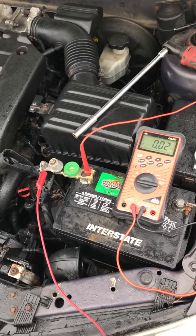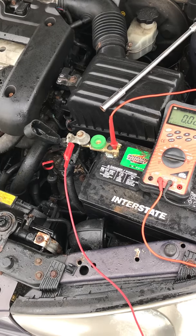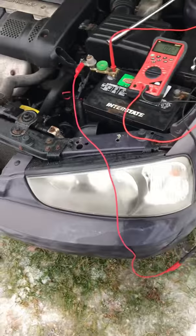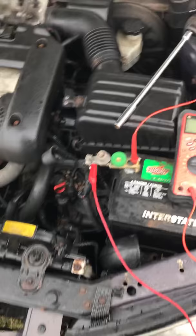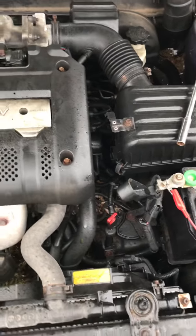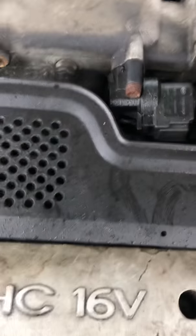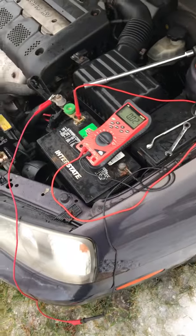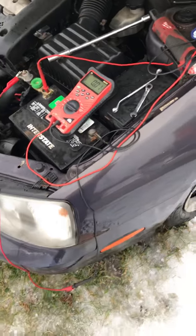Alright, wish there was a pause button on this. So if you want to skip ahead to, let's say, 5 minutes, and then we'll start up again. There's other things wrong with this car. We have a check engine light for a purge valve. I'll probably be changing that. I believe that's the purge valve right there. Yeah, here in Wisconsin you get a lot of rust, and those vapor emission return lines to the tank rust out on me, and you have to smoke test it.